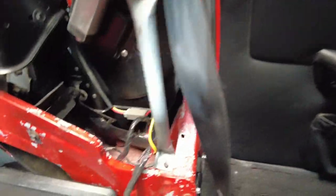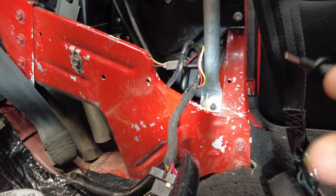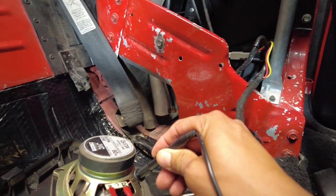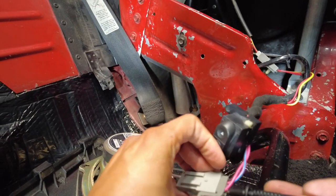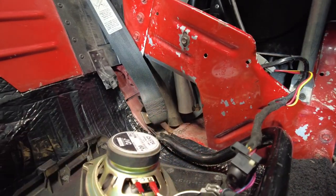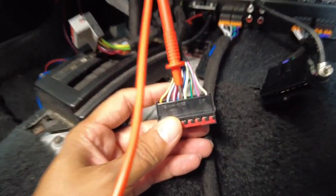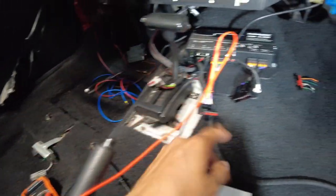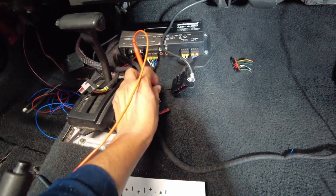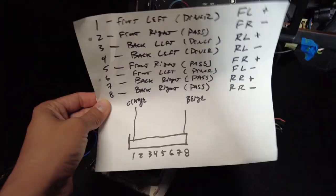So we're going back here. I'm going to flip these little speakers over because these are my testing speakers. It's beeping — what does that mean? So if we come over here and I stick the probe here, that pink wire — what that means is that pink wire is in reality that blue wire with a very faint pink stripe. You guys can tell there is no faint pink stripe on that wire. So this is a great way to tell which one of those wires goes where. It's a really important test because, due to Ford's drunken behavior in the 90s, your pins were probably wrong from the factory.